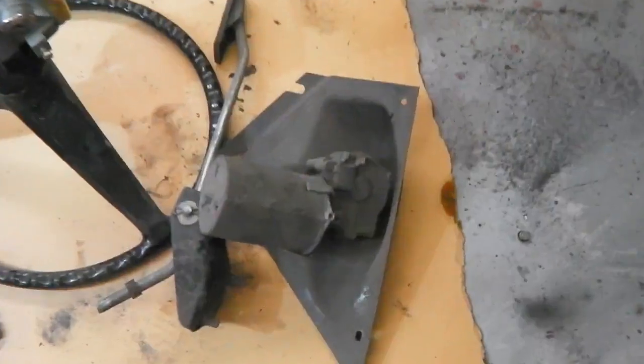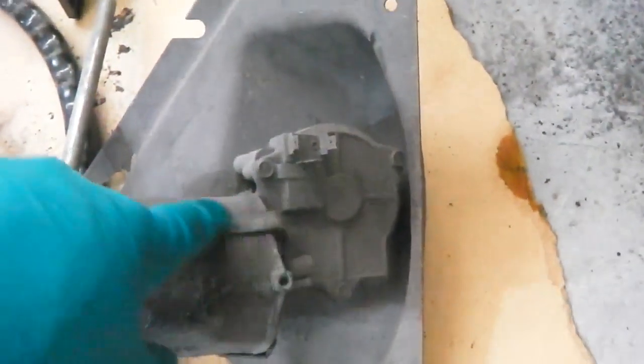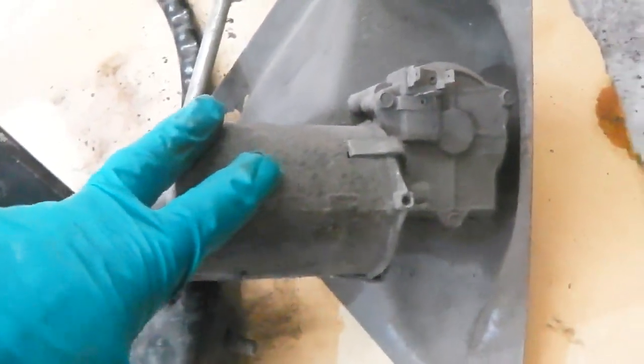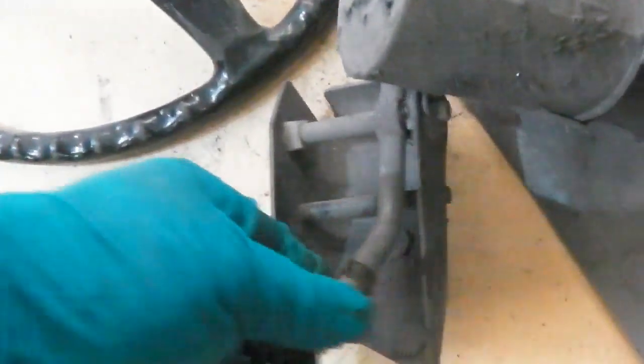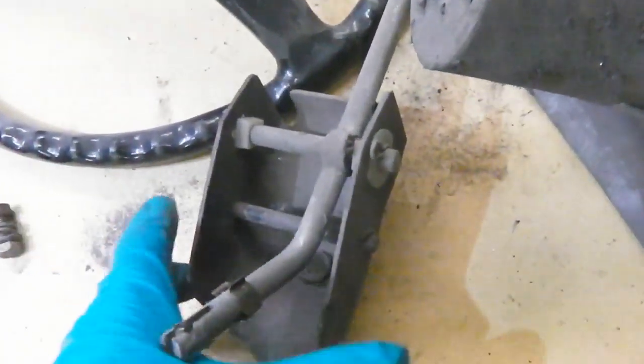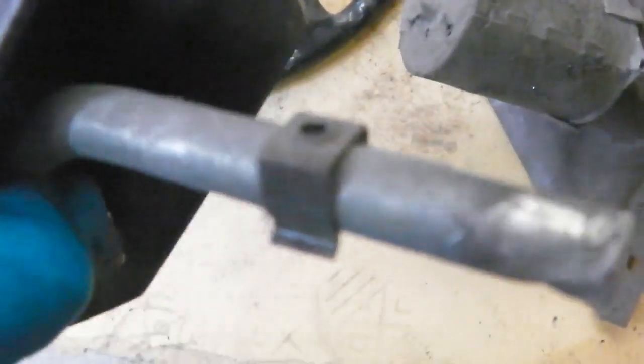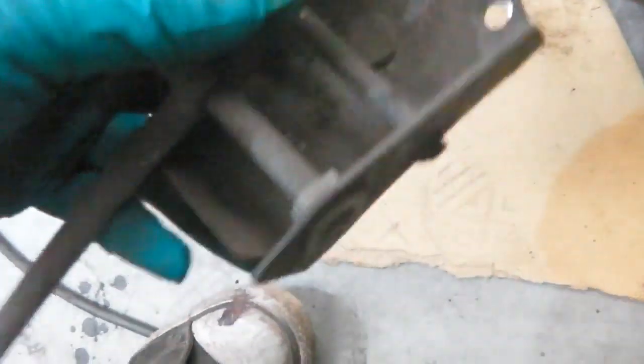There's some clips to do on the windscreen motor. We'll flip these off, we're going to galv them. The casing gets coated as well. And as I said, the accelerator bracket just needs stripping down. You've got a few choice little rare clips, like the accelerator holding clip, very hard to get hold of if you lose those. Some little split pins, so leave them all as a little kit. They won't get coated, they'll be put in a plastic bag and locked away safely. Same with a little fixing kit down at the bottom for the accelerator pedal itself.